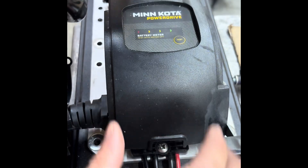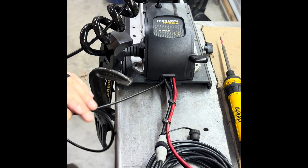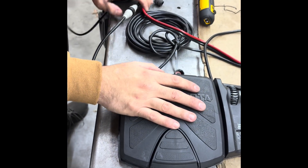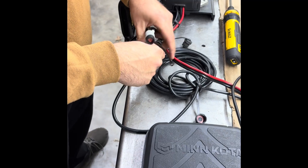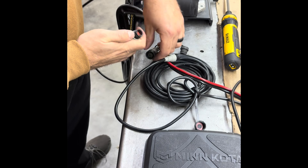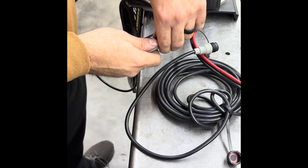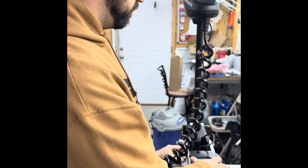Make sure you've got it all aligned. Watch this wire up front because you don't want it to come through incorrectly — you'll hear a snap, and that means you've got the two clips set. One important thing: once you upgrade to this Advanced GPS you do lose your foot pedal function, because your remote now takes over the foot pedal and gives all the commands to the motor. So you will have to disconnect your foot pedal. Then you'll connect the new Advanced GPS head into it. Once it's all hooked up, put your side plates on with the two screws.